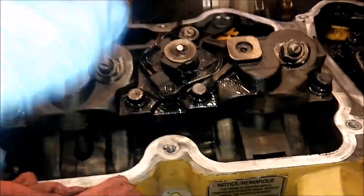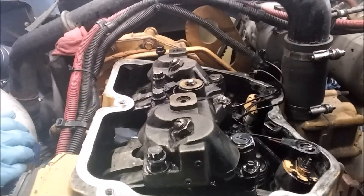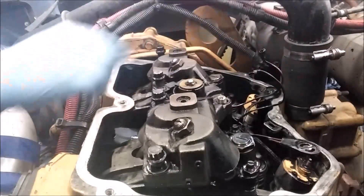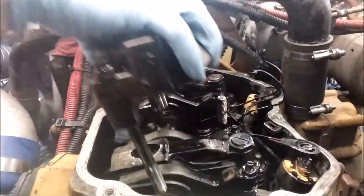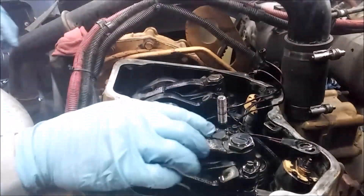Here is your number one and number two cylinders looking from the rear. That's number one injector — the one I'm going to be showing you how to change. After you remove the bolts, you're going to remove your jake housing. I always leave the bolts in so they don't go flying all over the place, and it helps to align them when going back in too. Your jake housing might be different depending on which model C-15 you have, but you're going to have to remove it either way because you have to remove the rocker arms, which are underneath.